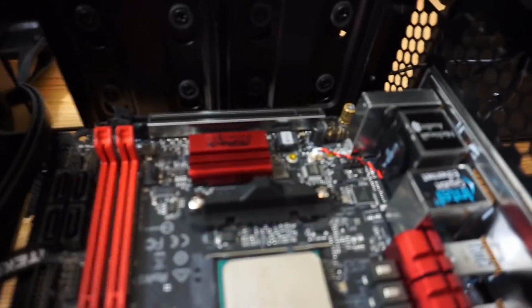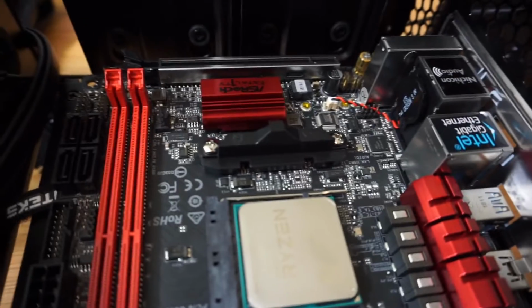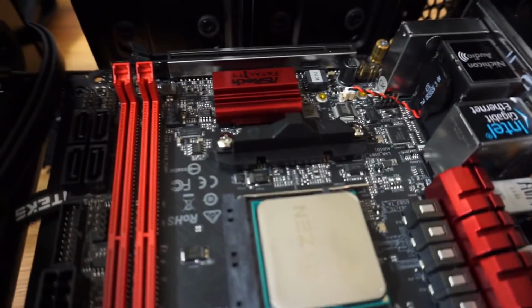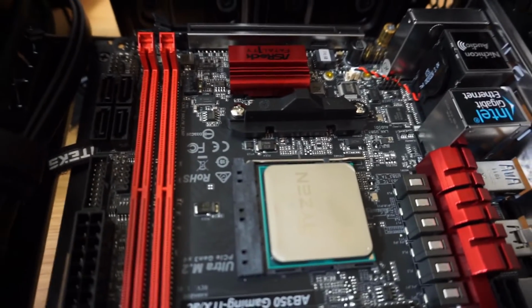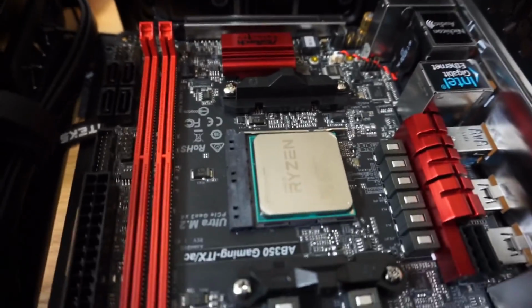So I forgot to mention, on these Captain coolers, those brackets have to come out. Normally I do that first. There's a back plate that has to go in, and then you screw the mounting setup on there. Because of the way this is laid out, there's so much room, I can do that later. Just pull these two screws, and those two screws pull those brackets out. There's a backing plate that goes in with 4 screws that pop up through. Then you put these retainers on. I'll show you as we go, but just letting you know that's why I didn't do it now.